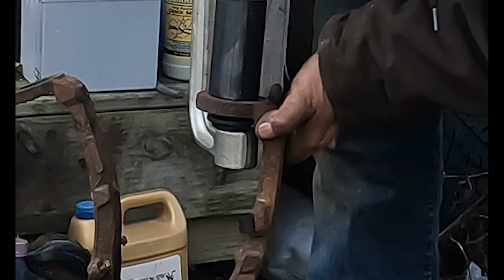So we have the axle, the new spring over shock. I did go and buy new sway bar links. Have to install those. So we just need to get the lower control arm jacked up so that we can get the upper ball joint into its home. And then we'll tighten down all the bolts. Okay, so I got it close. And I took a pry bar, put it in between the springs, pushed down so that it would seat so I could get the bolt through the slot.